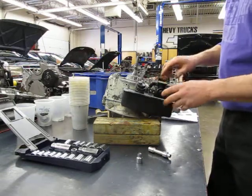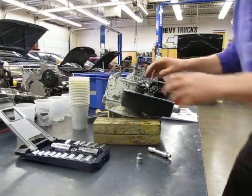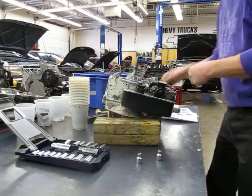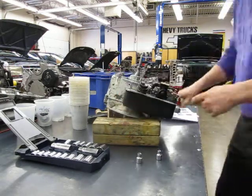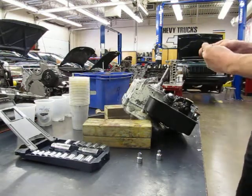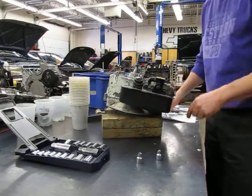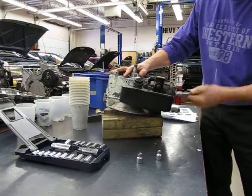Now I'm going to take the gas tank off, and this is the carburetor — I'm going to take it all off as one. We have a bolt here and a bolt back here. The one back here is seven-sixteenths. Notice I've got the engine on two wood blocks so the crankshaft, which runs through the bottom, keeps it off the ground — it's a little easier to work this way. So put it on two wood blocks when you take it apart.